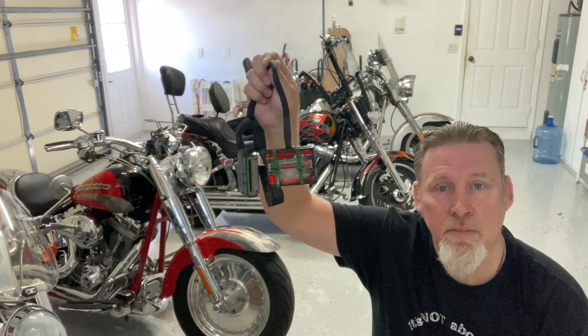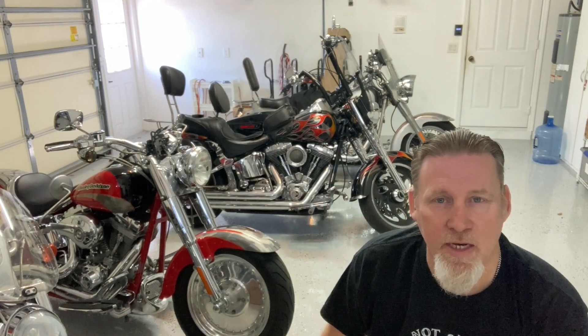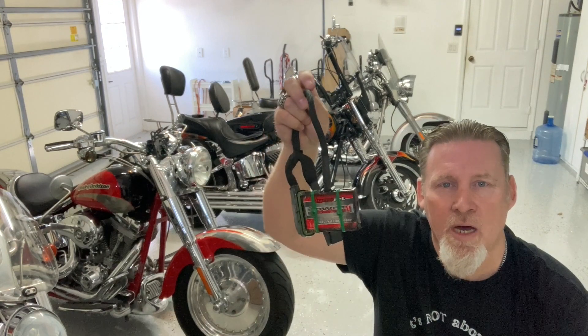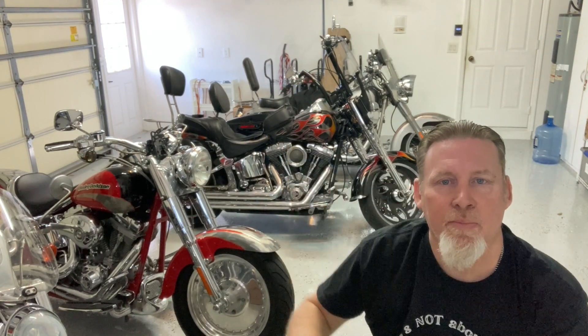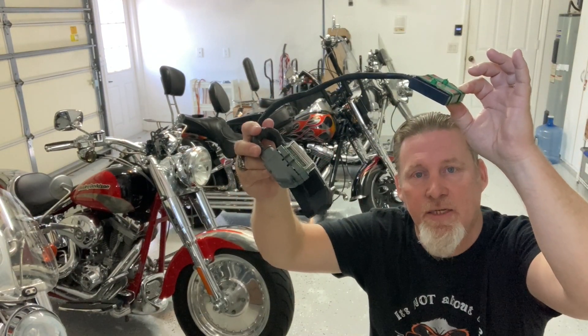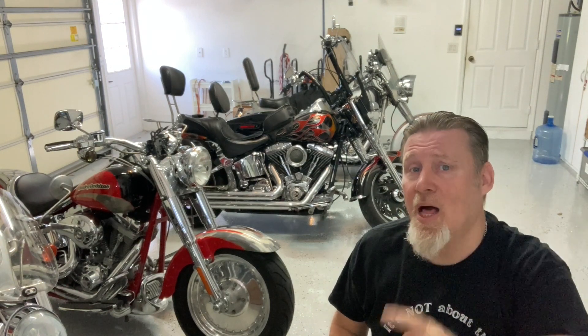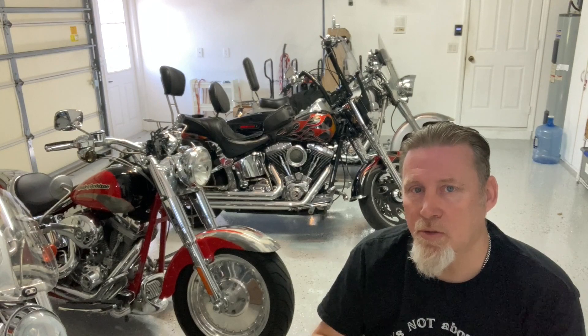With new cams comes a tuner. The shop I was at sold me this Power Commander, and it's been on there for about four years. When I first got the bike, within the first three weeks, I was riding in Naples, Florida. It was hot, I would turn the corner and my bike just died. I could turn off the key, turn on the key, start it back up, and it would run for a while and then it would die. So I took it back to the shop and it ended up that this was getting too hot. We moved it because this is mounted underneath the seat — it plugs right into the harness for your ECM, and this box is mounted underneath your seat somewhere.